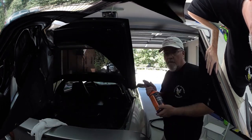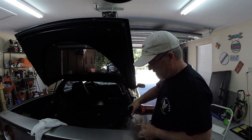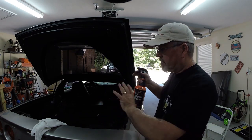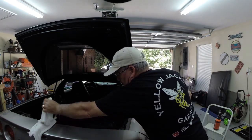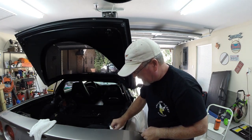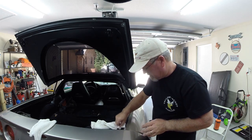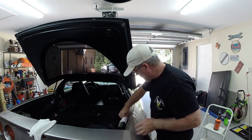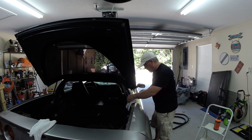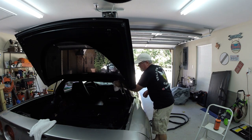Let's go ahead and put in the new seal. We're going to use a little bit of Meguiar's Detailer Citrus Power Cleaner to do a clean around these mating surfaces — clean them up, wipe them down, make sure they're clean before they go back together. You want to be careful because this is fiberglass and this car was in an accident so some of that fiberglass is damaged. The last thing you want is to get this stuff in your fingers — there's still a little bit sticking up in places so I'm feeling the rag as it catches and I'll stop rather than force it.